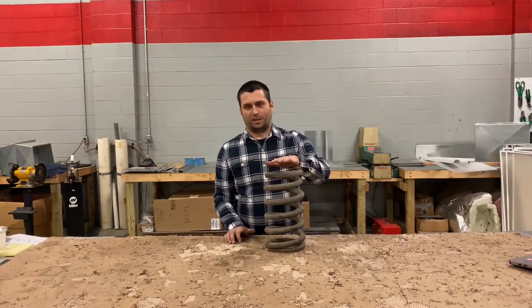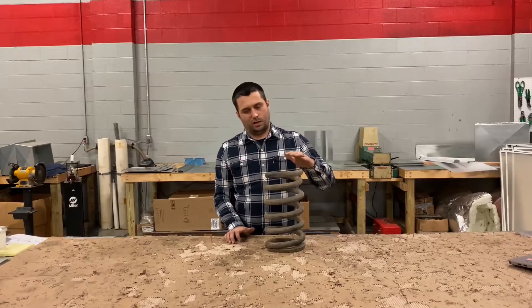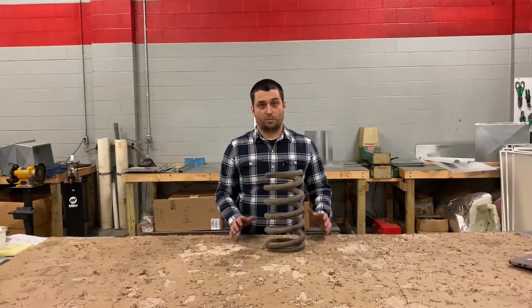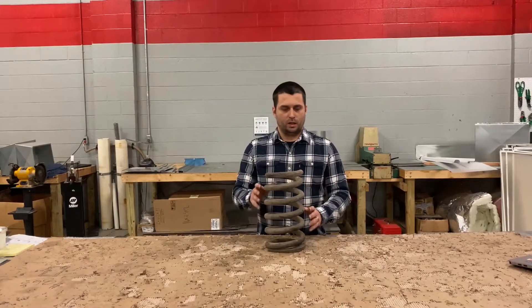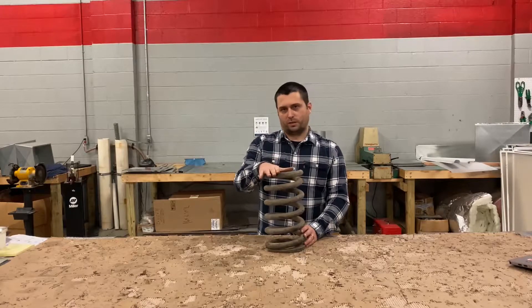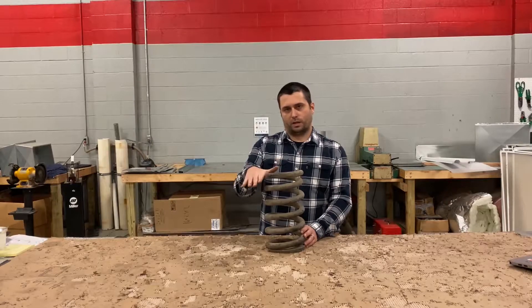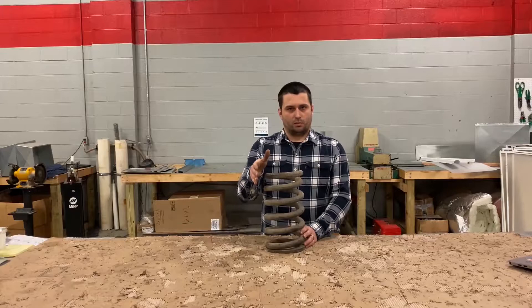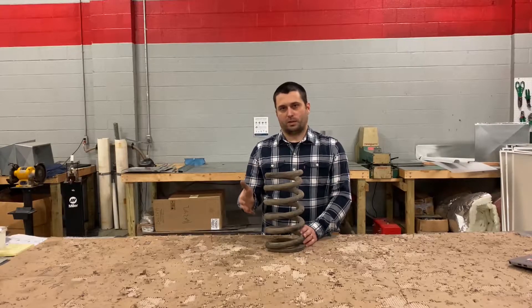The height of the spring has been crushed by about half an inch, so it's a half an inch shorter than it was brand new. When talking about spring rate, that refers to the compression of the spring. If the spring is compressed one inch and we put it on a scale, we should see roughly 954 pounds — that's what this spring is rated at.